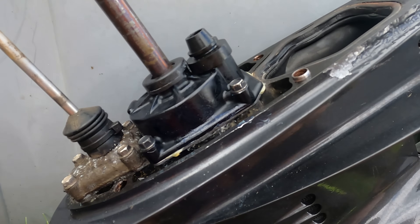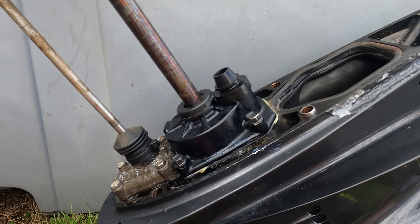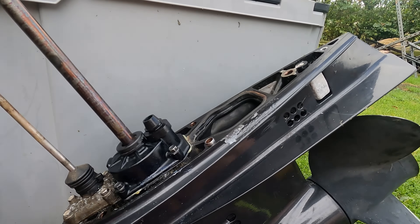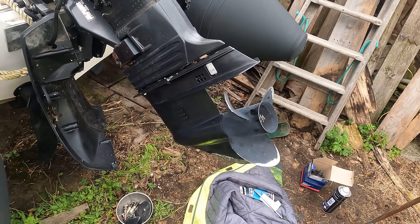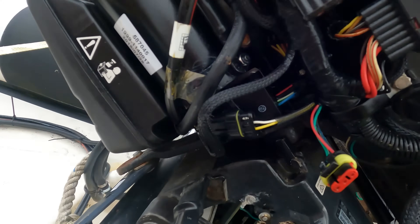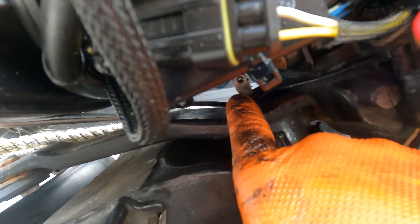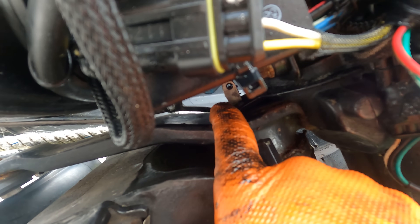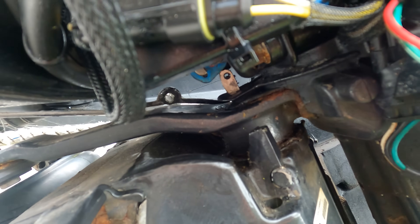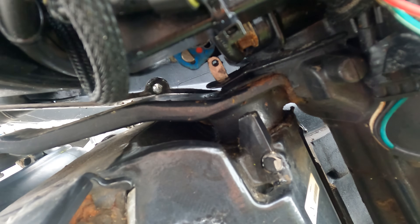Pretty straightforward — reassembly is basically the reverse. One thing I like to do is use the tip of the drive shaft to line up with the splines in the power head before reassembling. I guided the leg back in, got one bolt just on the threads, and took some alignment with the power shaft. On this one I noticed the grommet that the shift shaft goes through was getting pushed out of the way, causing the shift shaft to go off direction. There's still a bit of clearance to come up, but that'll get taken up on the gear case gap.